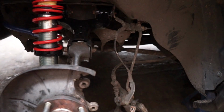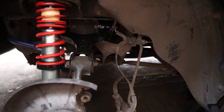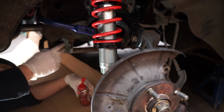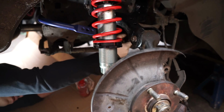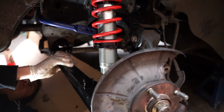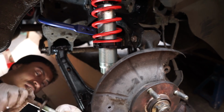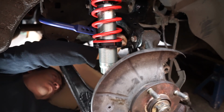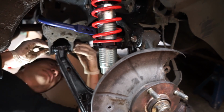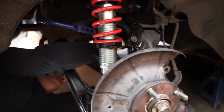Stunning. That's the hub now attached to the upper wishbone, as you can clearly see there. Stunning. So having learned from the previous hub being put in, I realized that maybe I should use some fairy liquid to make it a little bit easier to put the lower wishbone in, and this definitely helped quite a lot because it was a tiny bit rusty or corroded, so it was nice to give it a little bit of slip to get that in there. And then once it was in, again, a simple case of fitting the cam adjuster bolts in and tightening up the nuts on the rear ends, very simple.